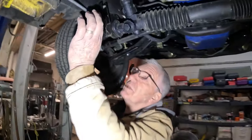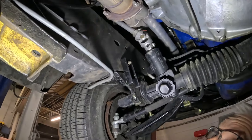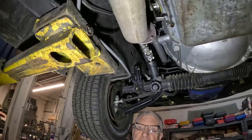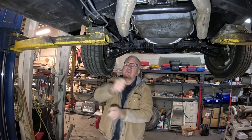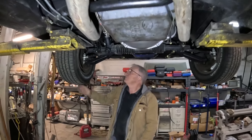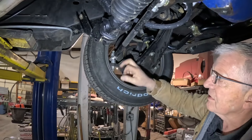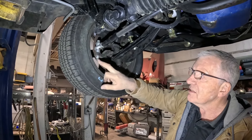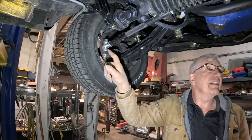Other than that it's looking fairly solid up here. There's the Flaming River rack and pinion — if you look right up in here there's a universal joint, and the angle is just too extreme. Even just driving through the car park, there are tight spots every time you turn the wheel — each half turn as it hits that tight spot in the u-joint, it just goes tight and loosens, tight and loosens. I'm going to talk with the owner about ditching this Flaming River. It's also got four-piston calipers up front — someone's done that upgrade. This is an adaptation for the Flaming River with rod ends and little spacers. It's just a regular bolt going through there, not a taper fit like the factory tie rod end would have been, so I'm not a fan of that either.